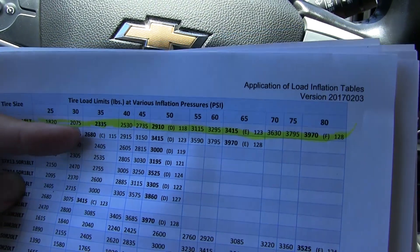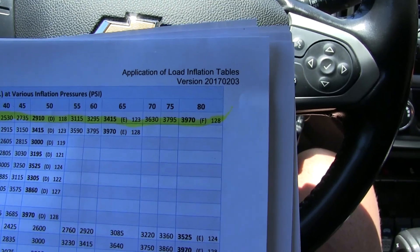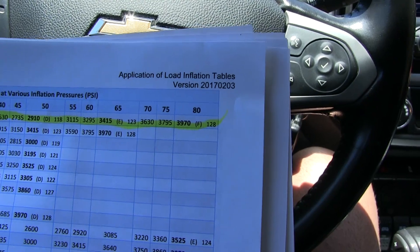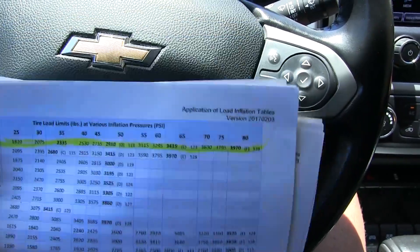The smaller tire was only 2,200 pounds at its limit, but this tire goes up to 2,500, 2,700, 2,900 — it actually goes up to 3,000 pounds. It has more load carrying capacity because it can hold more air as the pressure goes up. Hope that makes sense. I'm just trying to make a quick video on this.